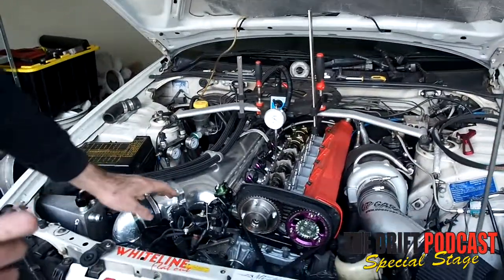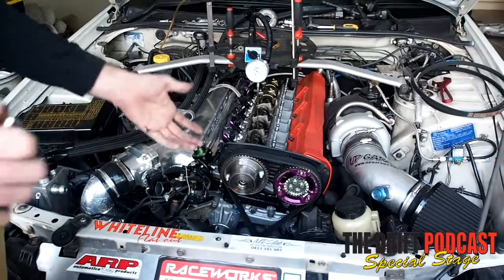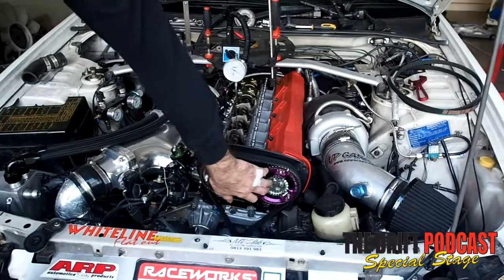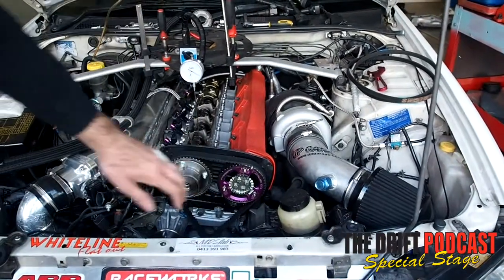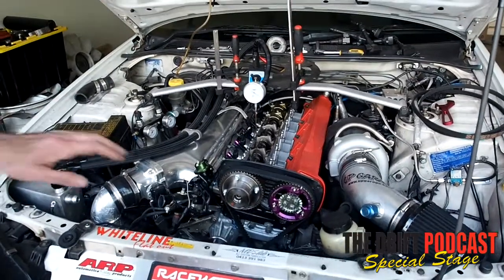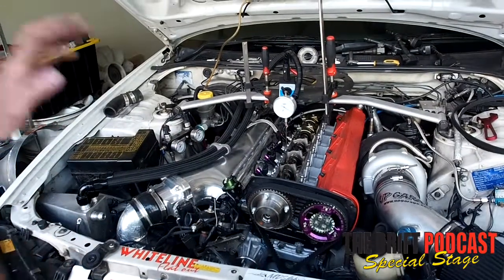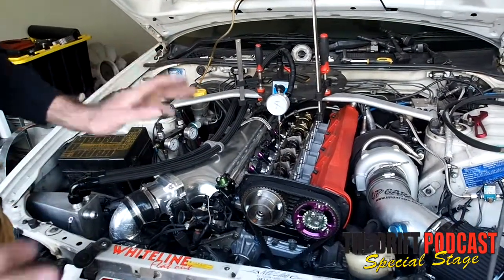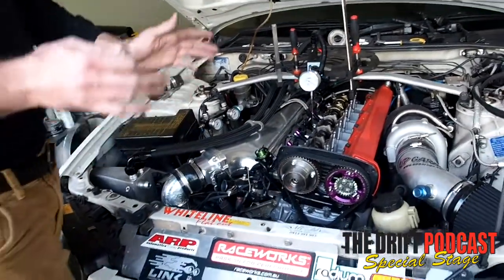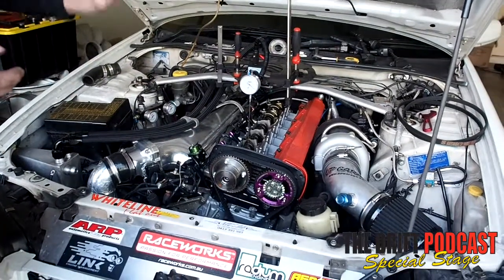This is an RB25 Neo. It has an aftermarket kit to adjust the actual VCT cam gear, and it has an adjustable on this side. We haven't actually bothered to do this on this side because we believe it to be correct. But this side has actually no marks, so setting up on the VCT side is a bit more difficult — especially when fitting aftermarket cams or even just changing this without doing this procedure.